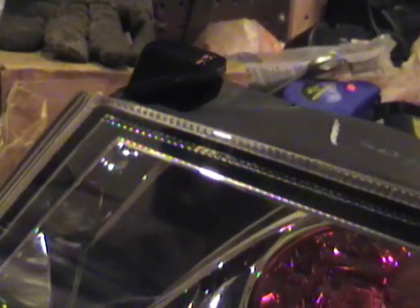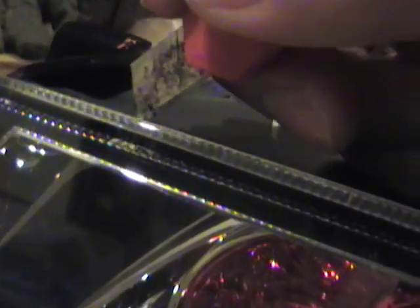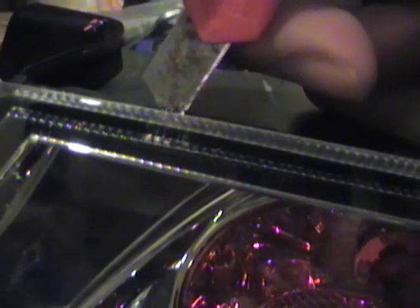I kind of took a break filming because it's easier. It takes a lot of heat at first, and I wasn't sure if I was getting anywhere with the blade, so I stopped filming. But I have started to get somewhere, and you can maybe see that it starts to get clear instead of what used to be black. You can see there's a black edge the whole way around. Well, when you know you're breaking it away from the glue, it'll get like that. My glue is kind of hardened by now, but I've worked the blade in somewhat. As you can see, it goes in about that far. The glue really isn't that thick. That's more than halfway through, so pretty soon it should puncture through to the other side, and then really all you have to do is keep heating the glue and pull along the edge.